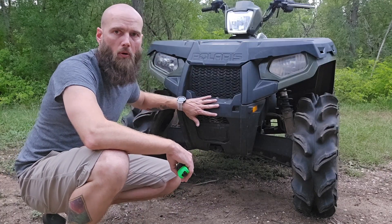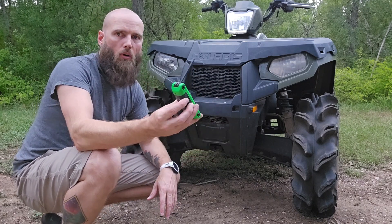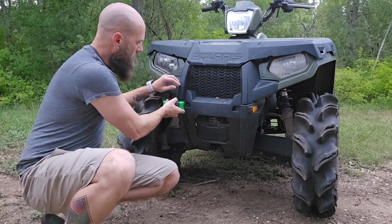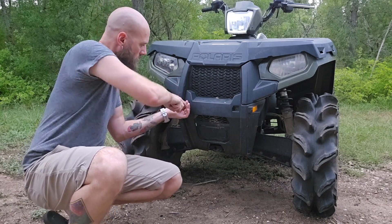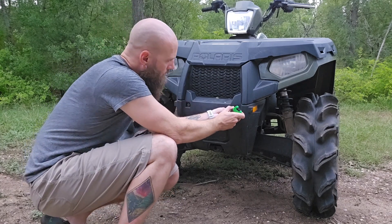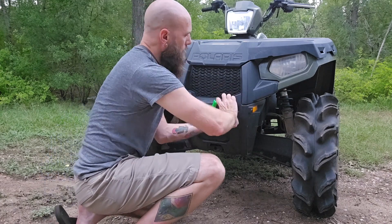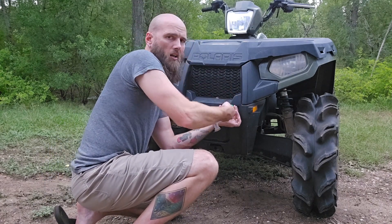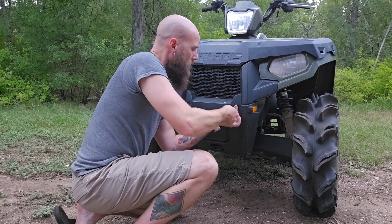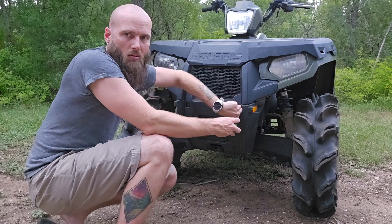Over here in front of the four-wheeler you've got a panel that comes off to get to the winch location. We're going to use a T27 — that's the correct size Torx head. You've got one here. I did already start loosening it up. What I would normally recommend is using my impact, but unfortunately I have a bunch of T25s and no T27s that I can locate. So for the moment we'll just pull off this panel — if I can find one to put it back on, that'd be great.